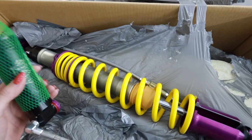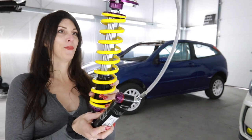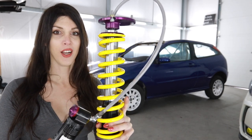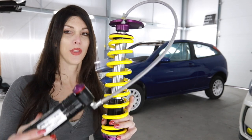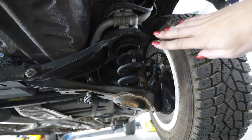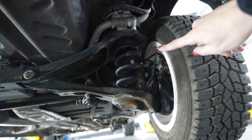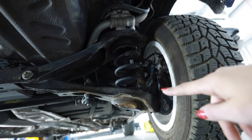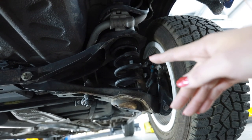It comes with a little cushion blanket — that's crazy. It's got a remote reservoir, this is so sick. Now this is just a test fit because these are custom spec for this car, not just a regular coilover meant for a Focus. It has longer travel but will still work with the suspension geometry on that car, and they're valved for off-road. What they ended up doing is last year I removed the coil springs from this car in the rear and front and then articulated the suspension all the way so we could calculate the maximum amount of travel possible with the suspension geometry, and then they used those parameters to make the coilovers accordingly.